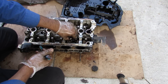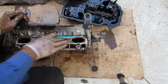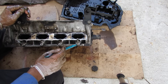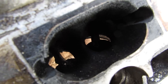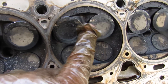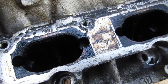Taking a look at the head, the valve train is straightforward with a roller rocker arm system, like any four-cylinder engine. One downside is that the ignition coils that plug into the spark plugs tend to fail fairly often, but they're not hard to replace. Looking at the front of the head where the intake bolts up, you can see the intake ports are really black and dirty. Underneath we have the four ports where the fuel injectors plug in and inject fuel directly into the combustion chamber — they don't direct fuel into the ports like a port-injected engine. Here's a closer look inside the intake port at just how much crust and crud is built up on those valves — it's pretty nasty.